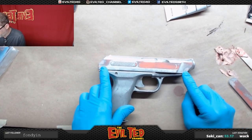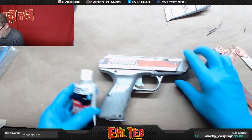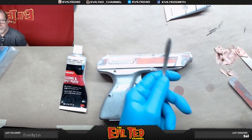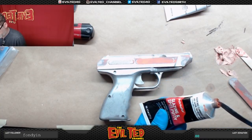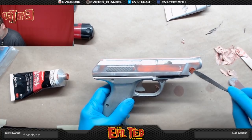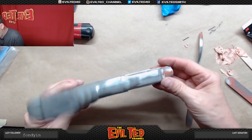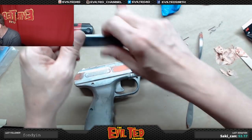The Bondo is sanded down, but the thing about Bondo is it's a good filler but not a great finisher - it still has a little texture and porosity to it. That's when you come back in with Bondo glazing putty. I'm going to go over the filled spots and also these seams. I'll clean things up - I take a razor blade and scrape off any excess Bondo. After about 25-30 minutes it's nice and dry, then I go back in with spot putty using a finer grit.